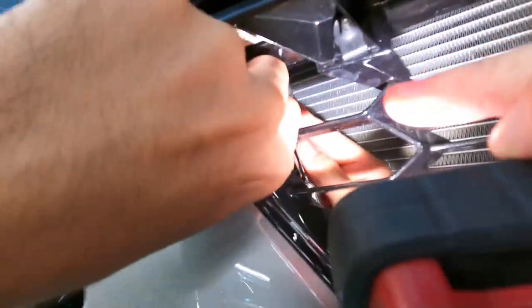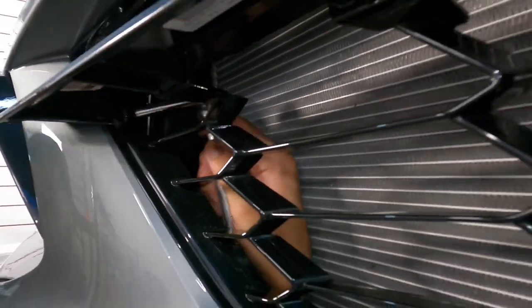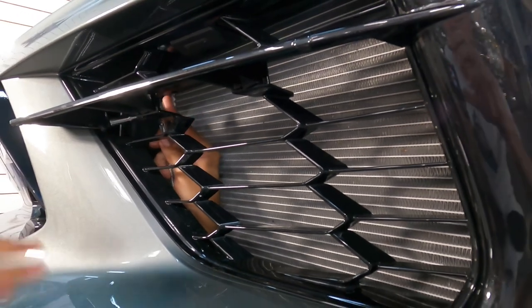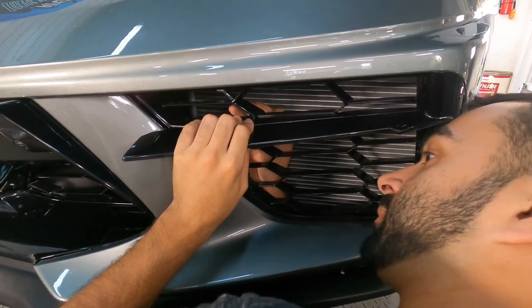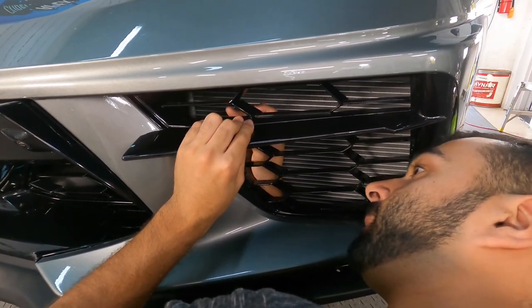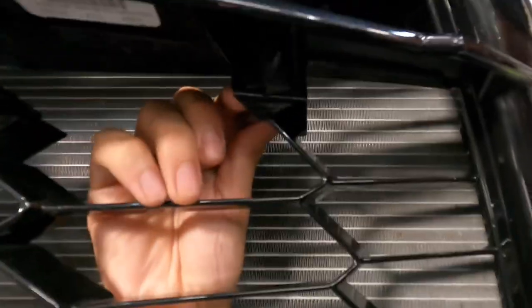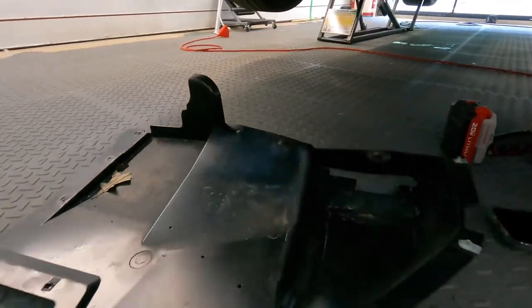The next thing you want to remove are three 7mm bolts and they go in from the back. I don't understand why they do it this way — that will be reversed when you are placing the grill or mesh insert in there. But for now, you need to get up in through with a small ratchet and the 7mm. Whatever works for you — if you have a stubby, you will probably find more room.